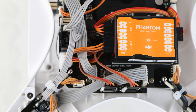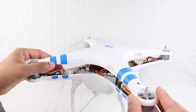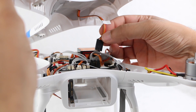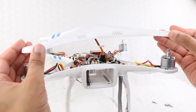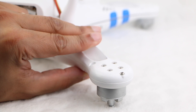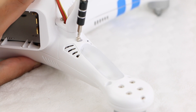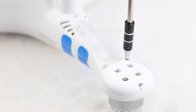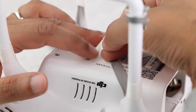Installation of the board is now complete. It is important to maintain the correct orientation when reattaching the top cover back into place, so line up the stickers previously cut. Before installing the top cover, remember to reattach the GPS cable, and lower the cover so it sits neatly back into place. Loosely reinstall all screws, remembering to install the crosshead screws at the very end of each propeller arm, and the hex screws in the remaining three locations, before giving them all a final tighten. Secure the gimbal cable using the previously removed tape if required.